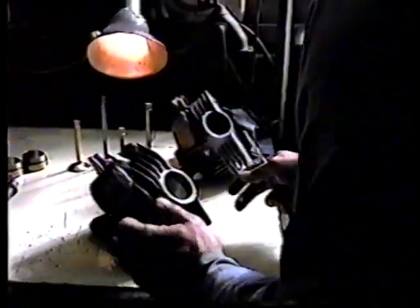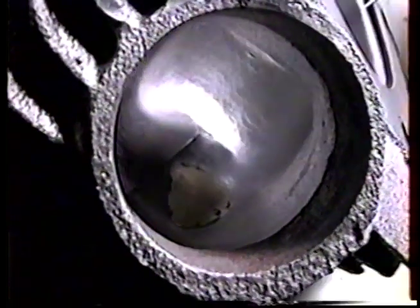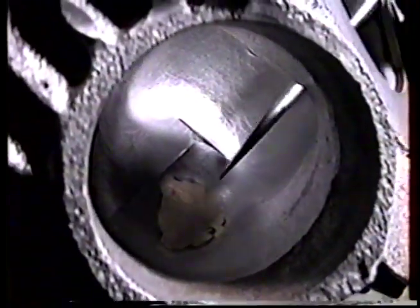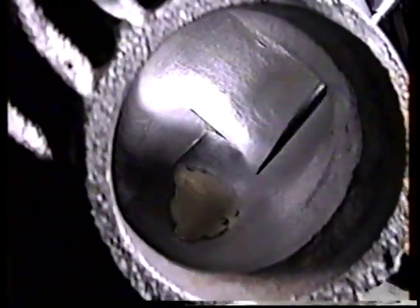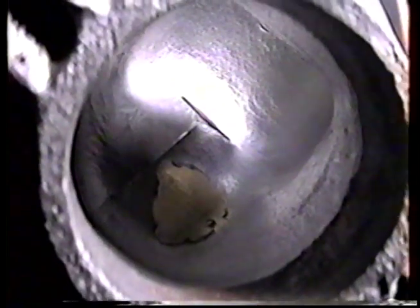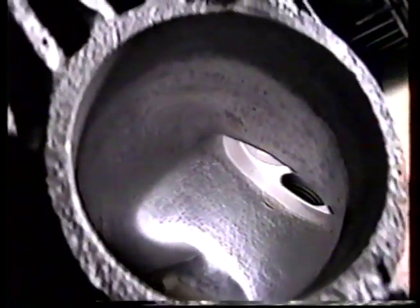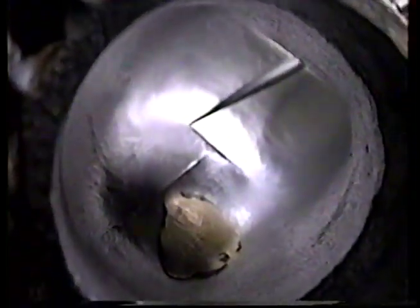Here's a finished exhaust port. The first thing you're going to notice is this big lump of weld that we put in here. On the exhaust ports, as a standard procedure in the process of removing that lump, we always find the air — we do that intentionally. Then we go back in and put a gold tooth in it so we get the flow up as high as absolutely possible. We make a ramp all the way up around the corners, right up to the edge of the guide boss.